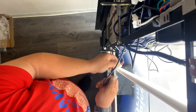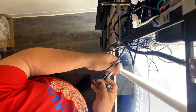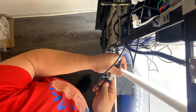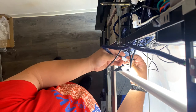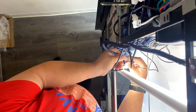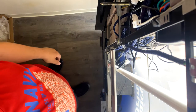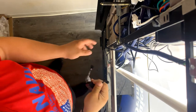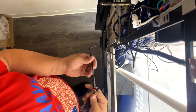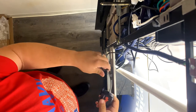Now disconnect the MDB connection and install the card reader in between. The telemeter always has to be first in line before any bill validators or coin mechanisms. On this machine, I still use a pulse validator. Here's the E-port power adapter for the USI bezel.